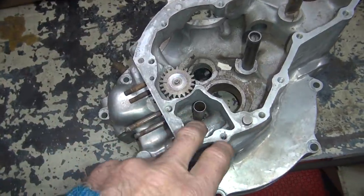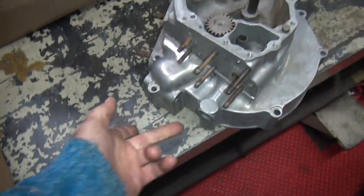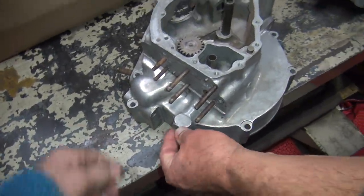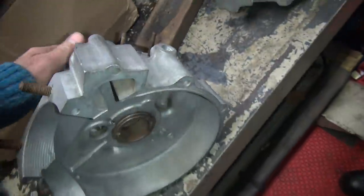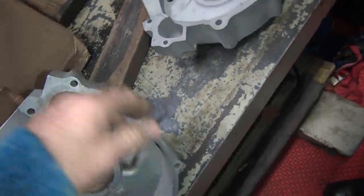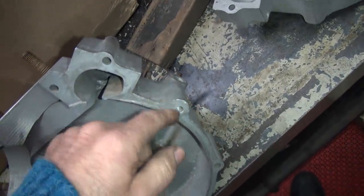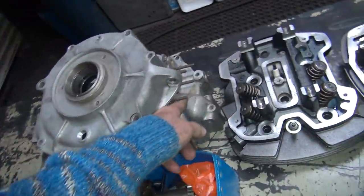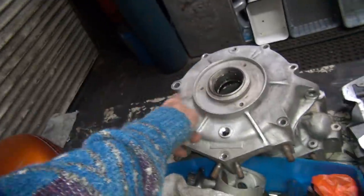This is what keeps this chamber dry - because if the chamber is not dry it's going to blow oil off the tube. Where does this tube go? It goes into the cam cover, it comes out here. On your bike you have a hose there. On the earlier motors they have a tube that goes across and only lubricates the primary chain - that's how they did it. This bike doesn't have a hole through here - it has a big hole out the other side and it comes across to lubricate your primary chain.